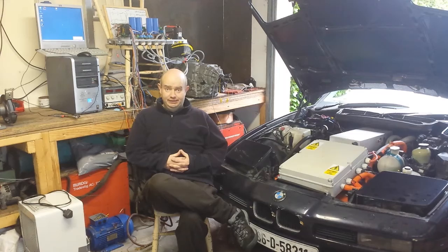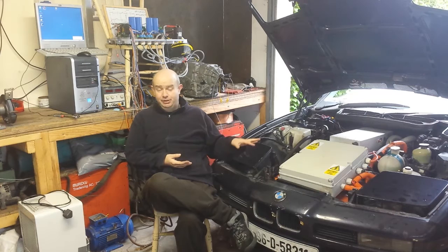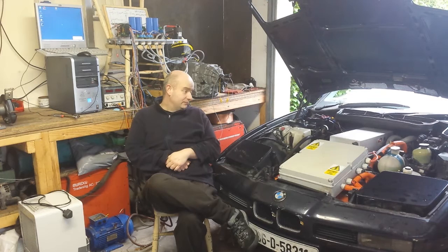Finally with the electrical stuff kind of working and the drivetrain all basically functioning, I decided to turn my attention to diagnosing what's wrong. I did some basic electrical troubleshooting yesterday, went into the module measuring voltages and checking the wheel speed sensors. Wheel speed sensors are one of the most common ABS failures due to their exposure to the environment, but to my surprise all four sensors measured up fine.